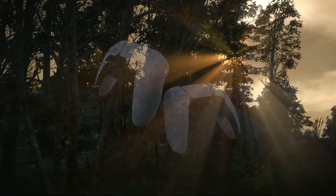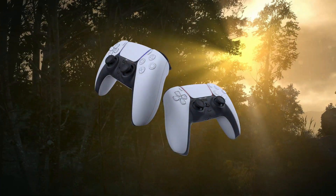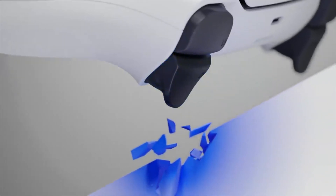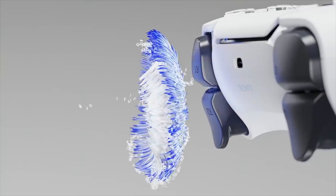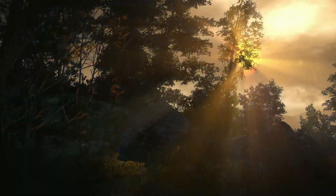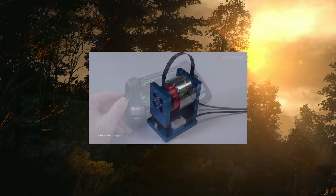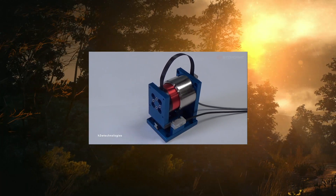The DualSense is a lot more advanced controller than the DualShock 4. Firstly, the trigger system has changed significantly — the new system implements haptic feedback on triggers based on trigger resistance, so players can feel different feedback from different objects in the game. The vibration system has also changed massively, as it's now able to simulate vibration of different parts of the controller based on actual game content. The traditional vibration system used a motor with an off-center weight, while the new system uses a spring-based actuator that can vibrate in a few different ways to simulate positioning.